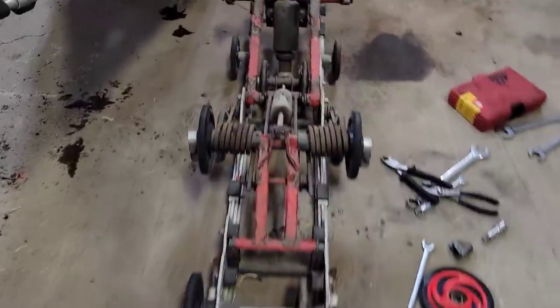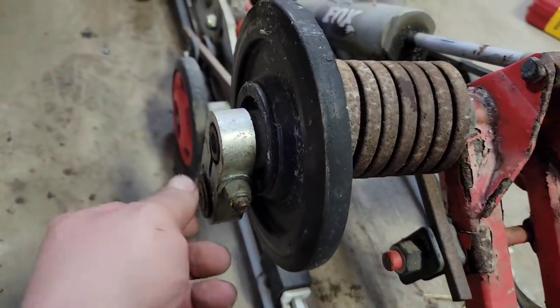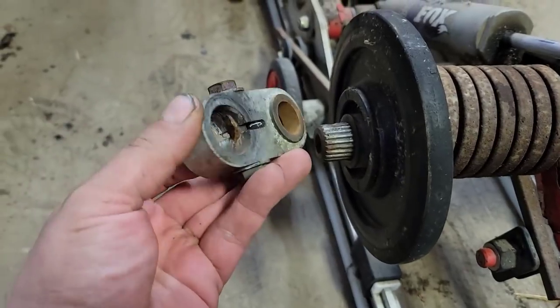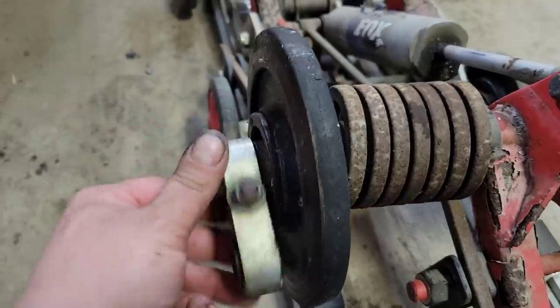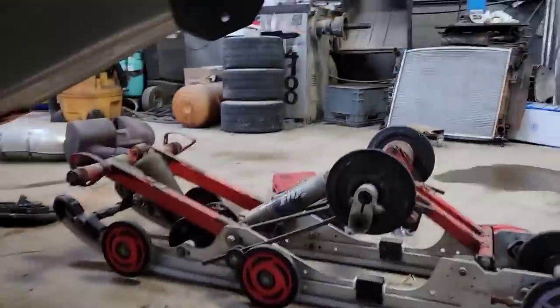Now, his skid, I mean, she's in a world of hurt here, but these bushings here, or brackets, they're supposed to be splined and keyed to that suspension, and they are wallered out. Like, you can spin them around and round. That, I do believe, is the major cause of what happened under here, because if we get looking up, yeah, worn right through the heat exchangers and the tunnel.